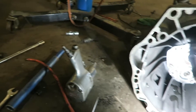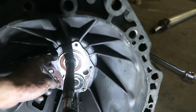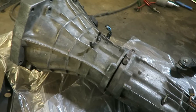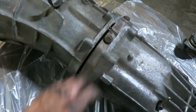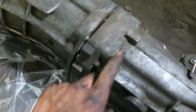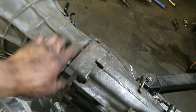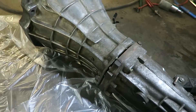On the front now - took off this cover, then got to take off this little clip here, and then we're gonna try to split it just to look at the gears and get the bell housing off. I totally could have recorded this, but I split apart the case right here - I just put a sacrificial bolt in there, one on each side, threaded it in a lot so it got a good grip, and hit it with a hammer a few times to split it.